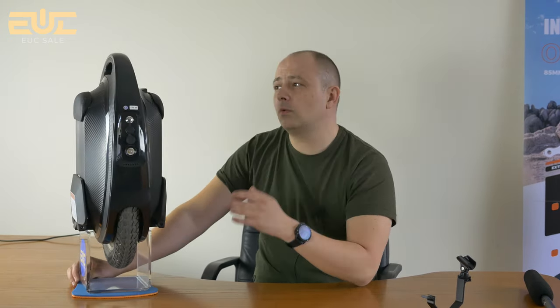So here we also have a hollow motor, and the main difference between the hollow motor and the usual motor is the torque from the beginning and the riding smoothness. So the hollow motor has more torque and more smoothness for the ride. This is definitely true, and that's why I think all manufacturers come to hollow motors here. But as I said, the problem still exists, and we will see how long the Tesla 3 will last with this hollow motor and this new type of bigger bearing. So this is the last main difference from the Tesla 2.